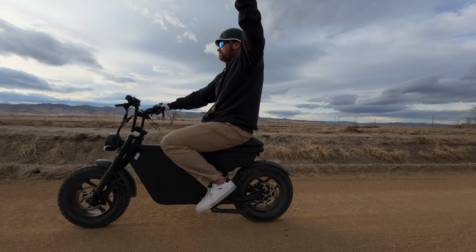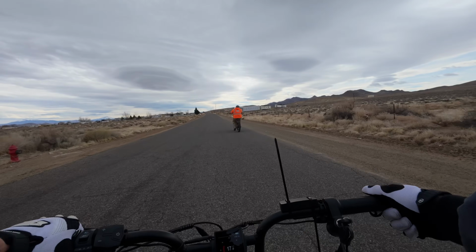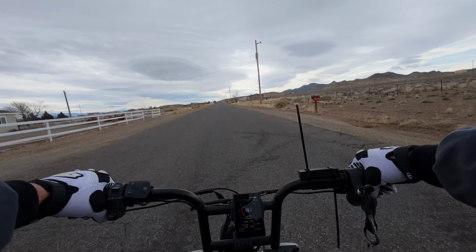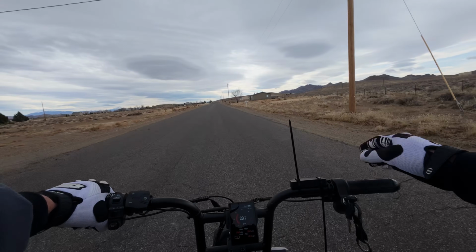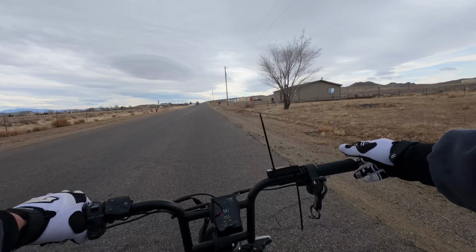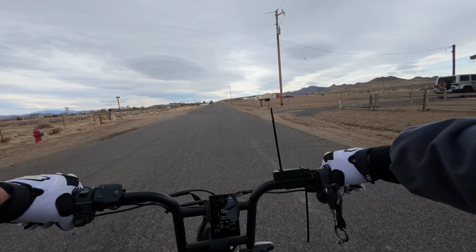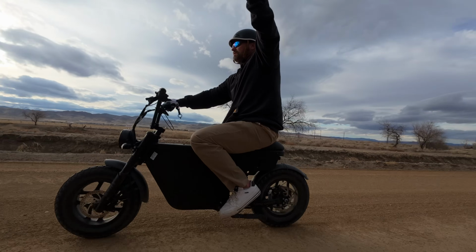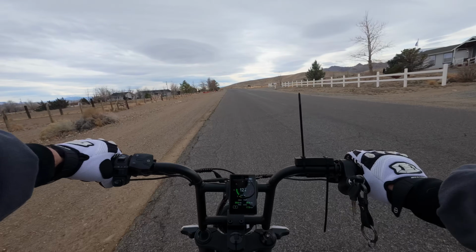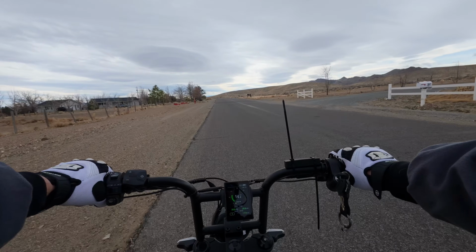I do think the throttle tuning can be mapped out smoother, so it gives you a gradual throttle pull instead of just an on and off switch. It's still very rideable, but yeah, it feels like it just gives you on and off. It gradually puts in the power when you pedal it, a little smoother than when you do it with the throttle. And I've messed around with start strength from 0 to 5, and it seems like they all still have the on-off throttle. It's not as jumpy as a geared hub motor would be, but it's definitely not the smoothest throttle. So you put it in pedal assist 1 or any other green, it's definitely putting out reduced power now. So I guess if you want to take it a little slower, you put it in the green modes.